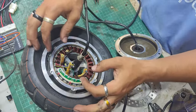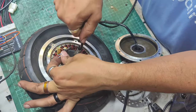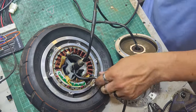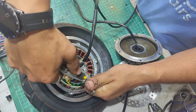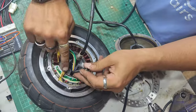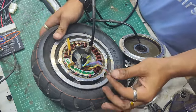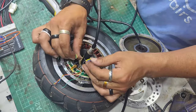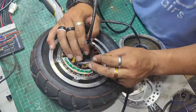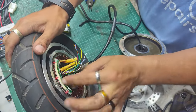Don't poke the bear and all that. So instead of dealing with those solder joints there, I'm going to solder onto here, here and here, because where they've got hot I'm pretty sure the wires it's not going to take well to fresh solder - it's just going to cause me grief trying to do it. If it hadn't got that hot I would happily consider replacing it all the way down, but I don't think it's a good idea in this case. So I'm going to do green to green, yellow to yellow, blue to blue, and then the hall wires are going to go back on - negative, yellow, green, red - and that must have been blue there.